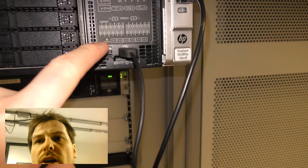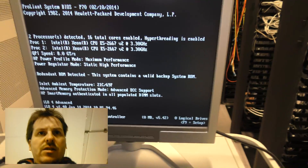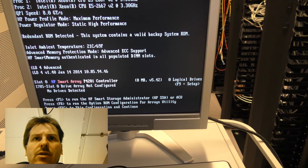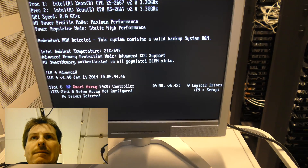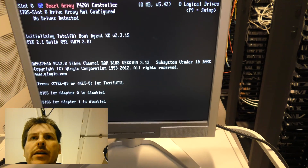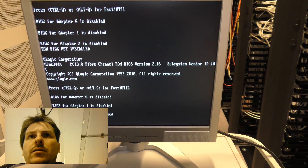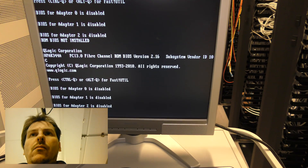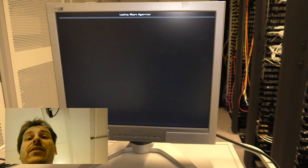It has its own diagnostics panel here, and it's not complaining about any of the DIMMs as of yet. It has recognized the CPUs, and there's a note that memory has changed. That looks good. I think this is going to be booting just fine — I haven't seen any errors so far. Now it's booting VMware, so I think this server is good.